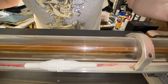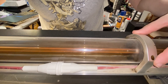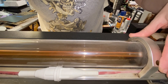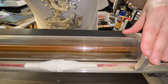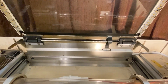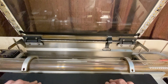Attach it to the end of your tube with a screw, route your wire through your cable management, and make sure that it's nice and stable and not flopping around. Make sure that as you slide your Glowforge tube back and forth, this insulation connector doesn't come into contact with or get in the way of your laser moving all the way to the back of your machine. Before you think you're done, put it all back together and gently with your hands make sure your laser moves back and forth and nothing is in the way of your carriage wheels, gantry wheels, or your traverse path. Make sure your Glowforge runs all the way to the back of your machine and that your splice housing isn't interfering with the traveling path of your laser front to back.